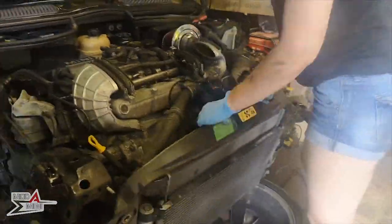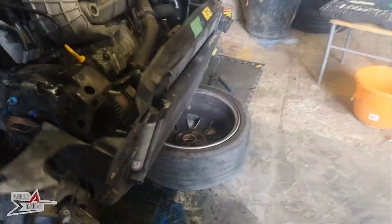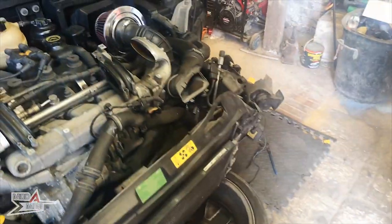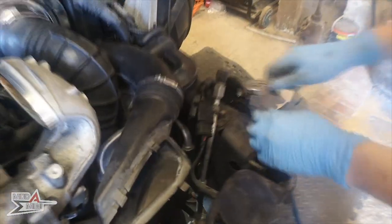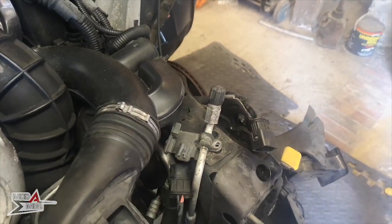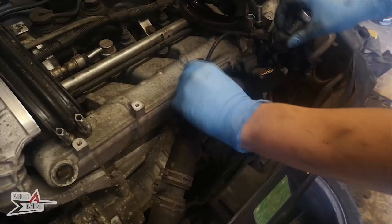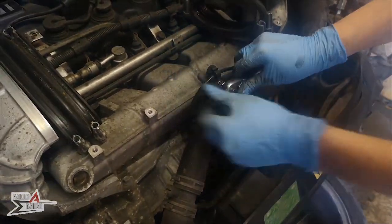Here I am just unclipping the electrical connections that run through the back of the radiator housing, so that I can lower the radiator housing without putting strain on any of the cables. There is also a wheel on the floor face down - I have noticed - but I will be refurbing these in a later video so I'm not massively precious. I can't quite lower it fully enough, so I will also be taking off the air conditioning fill pipe, which does take about 3000 years to undo due to the ridiculous length, and then also the top radiator hose. This will allow me to tip it even more forwards to get even more room behind it.